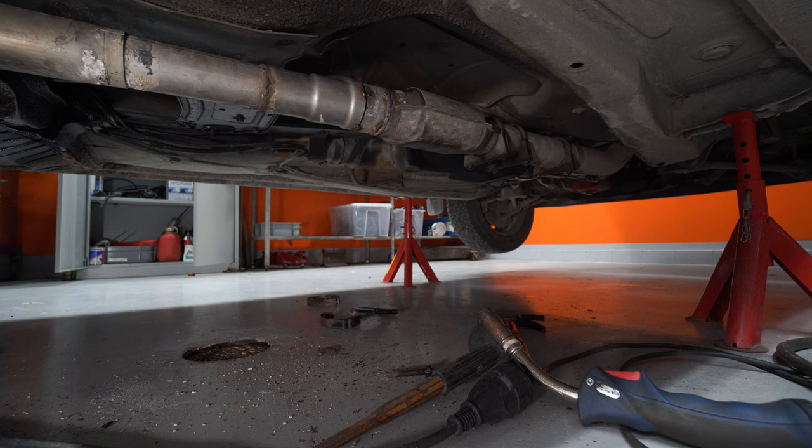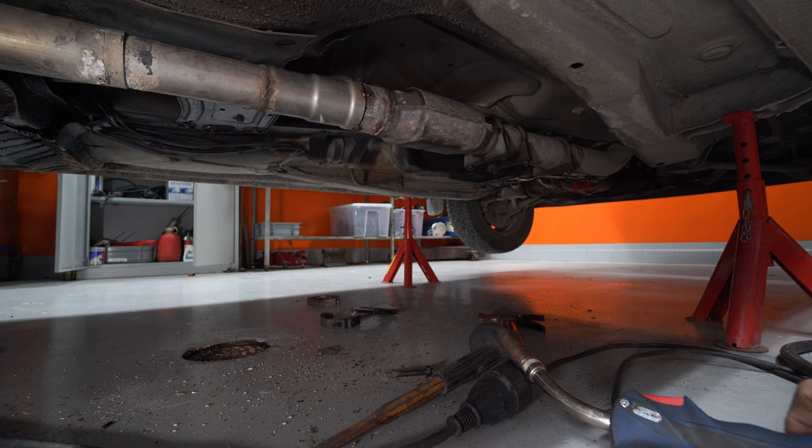That's not the prettiest I've ever done, but welding underneath the car is something that is just hopeless. I'm not using stainless steel wire, so it's not going to be perfect, but that does not matter — this car is not about being perfect. What we're going to do now is remove the entire downpipe and weld this up on the table. We're going to clean it up, weld it up, and then put it back — job done. We're going to remove these clamps so it will be one piece, this whole thing, and then we'll put it back on the car.